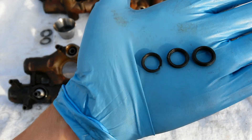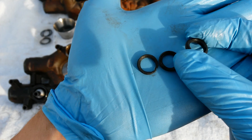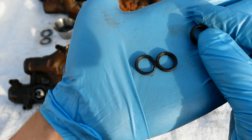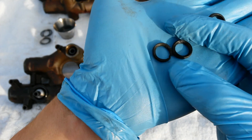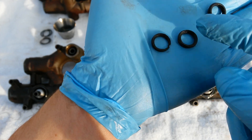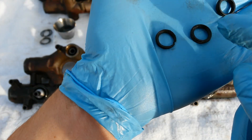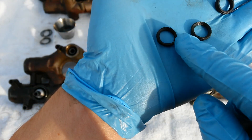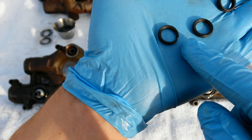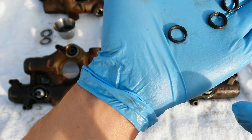This is what you're going to see. This here is a brand new seal — it's got nice smooth edges, looks like an O-ring should. This one here has started to get eaten down from the top by the nipple cup seal above it. It's going to look rough and sanded — that's from the high pressure oil shooting down onto it from above at the nipple cup O-ring.